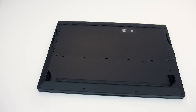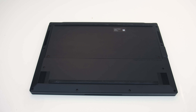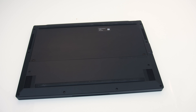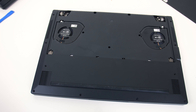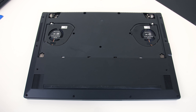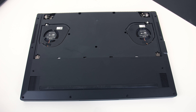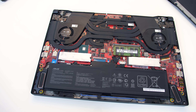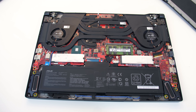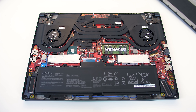To get inside we first need to take out 8 Phillips head screws from the base, then 4 more screws in the metal plate that gets pushed down when the lid is opened. Under here we can see the two fans that pull in air, and then there are 5 more screws under the panel to remove. Once inside we've got the battery down the bottom, WiFi cards soldered to the board, two M.2 slots under the silver heat shields, and a single memory slot.